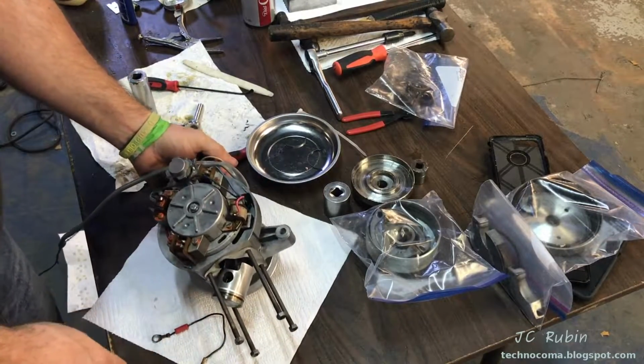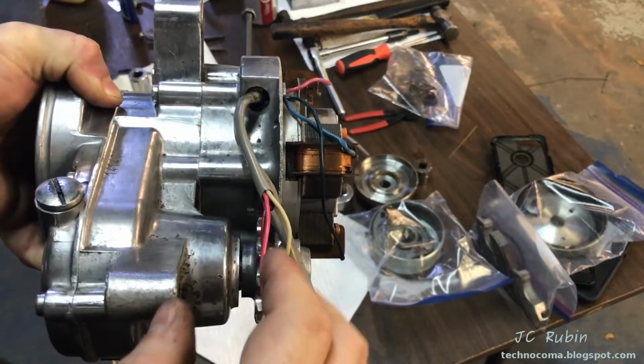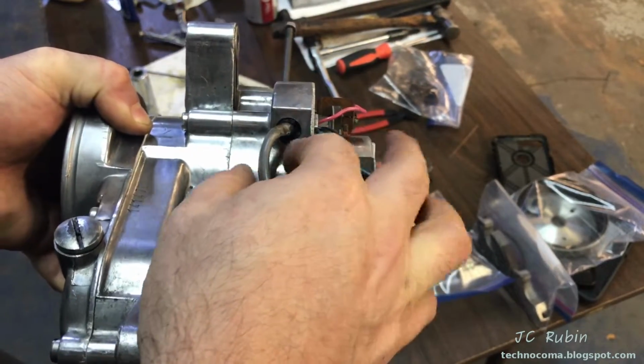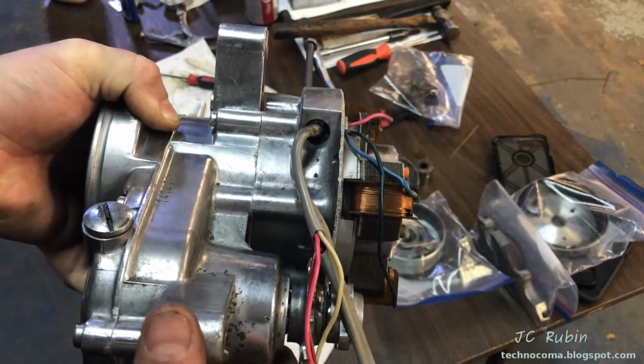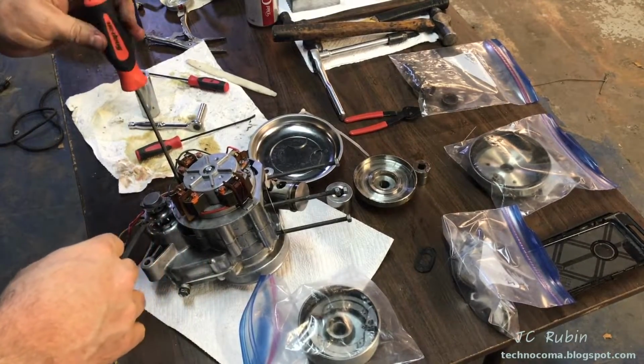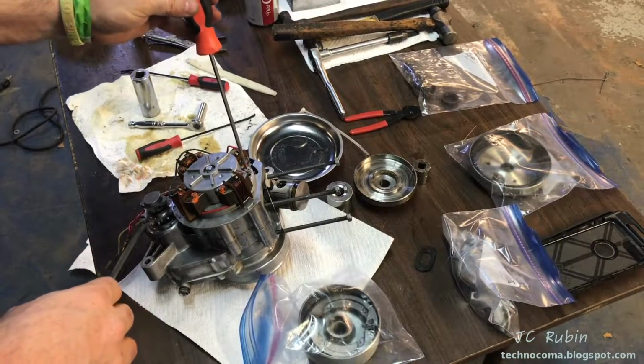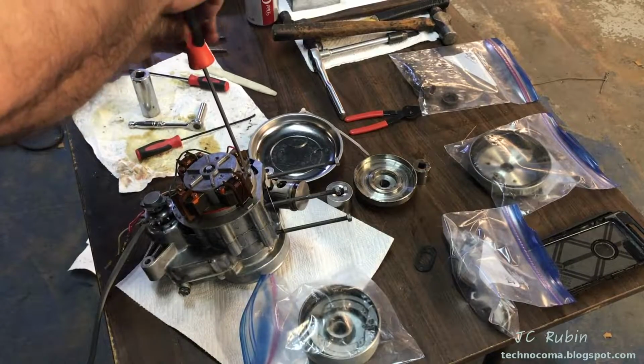I have to work that grommet back into position up here. There's not much grommet left on this side. I'd probably use some RTV here to seal this up so no water gets in, but that's just fine. Put in the 2 screws that are used to adjust the ignition timing and hold this all in place. Obviously, I'm not setting up the timing now, just getting it together.